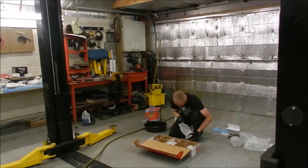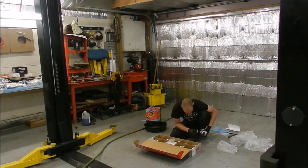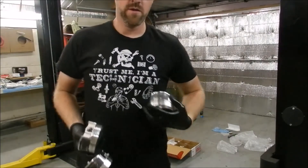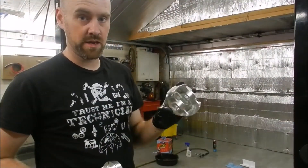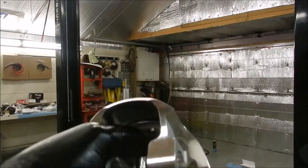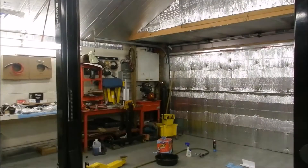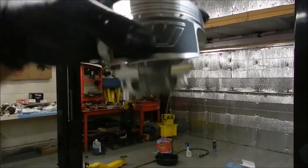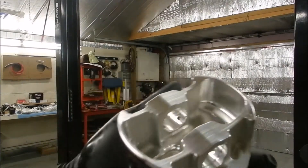So right now I'm looking over the pistons to see if the guy had to balance any of them. Every once in a while you get lucky and they don't have to get cut up, but it's very rare — usually they have to be cut at least a little bit to get them to come into balance. So I'll show you what we have here. We have this piston here and it does not have any grind marks whatsoever in it, other than the factory spot. See right here in that center spot — but look right above where the wrist pin goes, there's no marking there. Then we have this one here — see the spot right above the wrist pin — see how that's got that mark cut into it. That's the balancing that he had to do, that's how much material he had to cut away from each side.